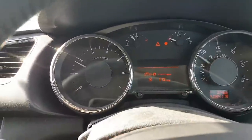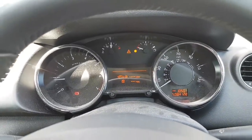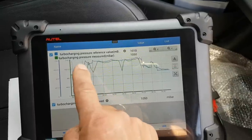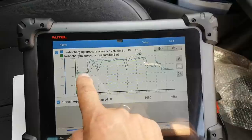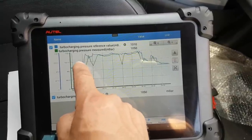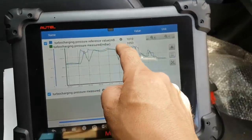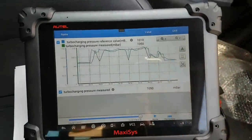First thing to show you: the car used to turn the engine light on if revved above 3500-4000 RPM for more than two or three seconds. Now it's pulling really, really well — no lag, no nothing, absolutely brilliant. Car is driving beautifully. Just paused the live data at an intersection on takeoff: green line is measured boost pressure, blue line is the requested pressure. There's a slight lag in second gear but you barely notice it while driving.